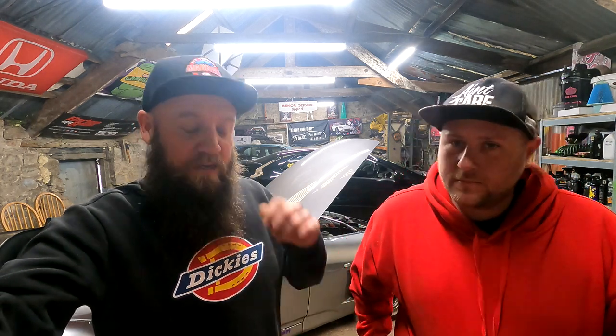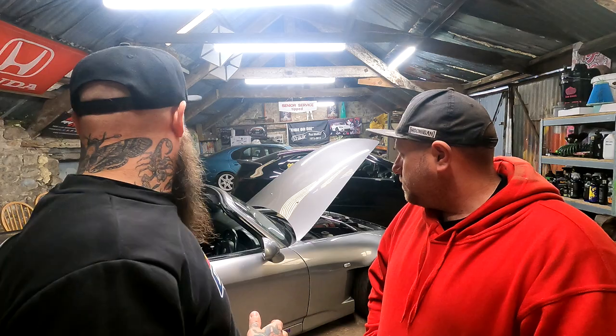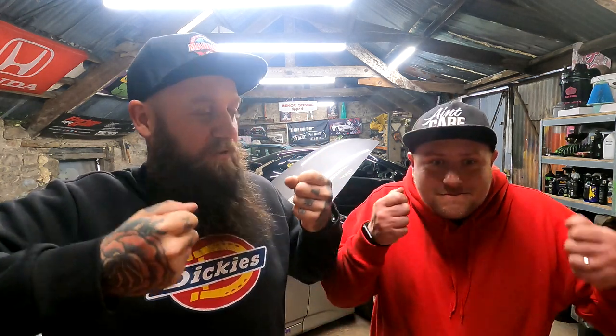We wanted to do it for a while. We'll show you a bit. Basically, we're fitting a new steering wheel to the S2K, the aftermarket steering wheel by Kode, which is kind of a stopgap to the 101. I got the short NRG hub for it, as I didn't want to go quick release because it brings it too far out, because I'm 6 foot. There's no adjustment on the steering wheel at all, and you can just slide backwards and forwards. I've got a little bit to go back still, as you can see. So I've gone for the short hub without quick release because it brings it off like that far, mate. It's a really long way, and I'd be like Dastardly and Muttley driving along.